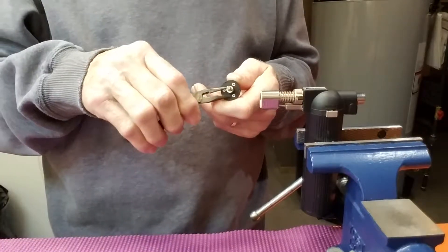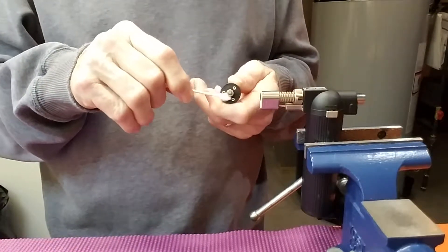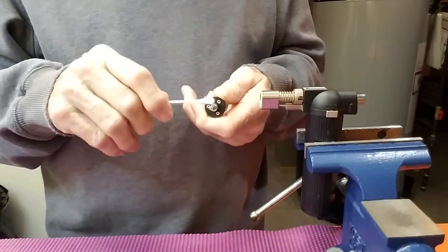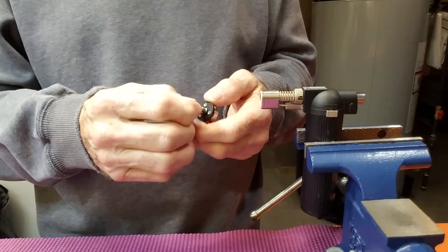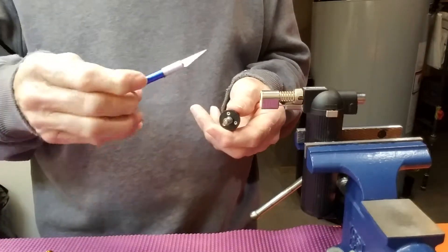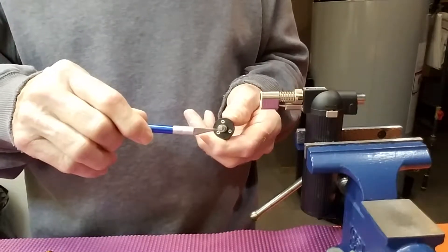Once you get it loose, don't touch it — the shaft is hot. Take more acetone and put it on the shaft all around here to cool the shaft off. It also removes the glue. When you get it cooled down, you'll be able to slide the magnet off. You don't have to take it off, just slide it up. You may have to take the exacto again and clean some of the glue off, because there'll still be some right at the top of that ridge.